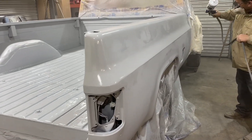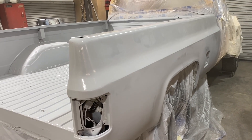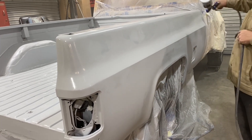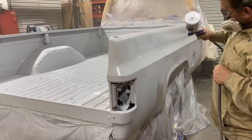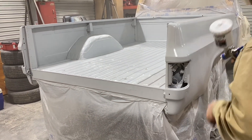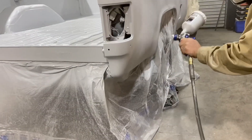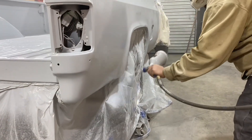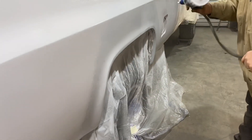This is the first time I've used what I'd call masking film — that's 3M masking film, I got it at a Sherwin-Williams store. Not real sure if I like it yet. I did buy a big roll of it, the 16-foot wide roll, just so we can get it as wide as the truck. As we move forward I'll end up using it, especially on the front, because I'm going to be painting everything black — the fenders and stuff — and I don't want to get those covered in overspray like I've already done. You guys can go back to part 2 of this video series and check out how I covered all that stuff in overspray.